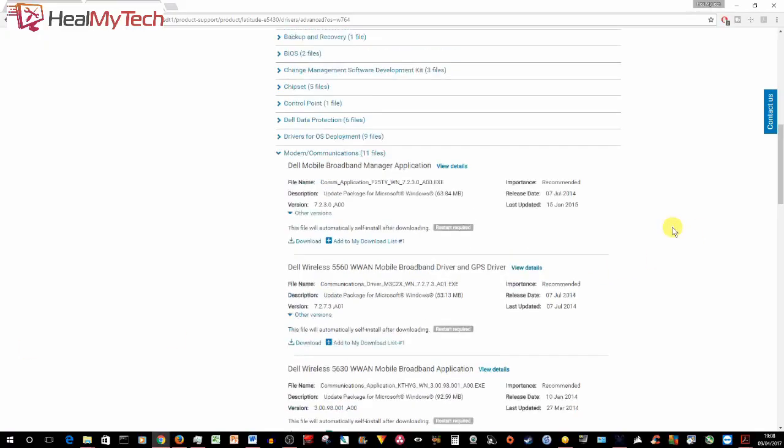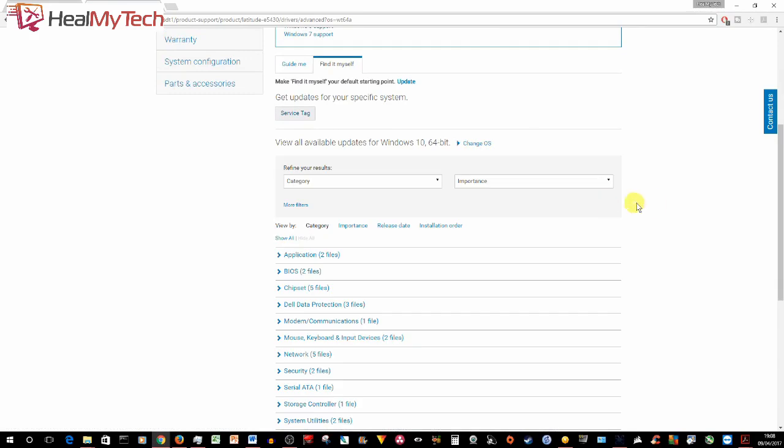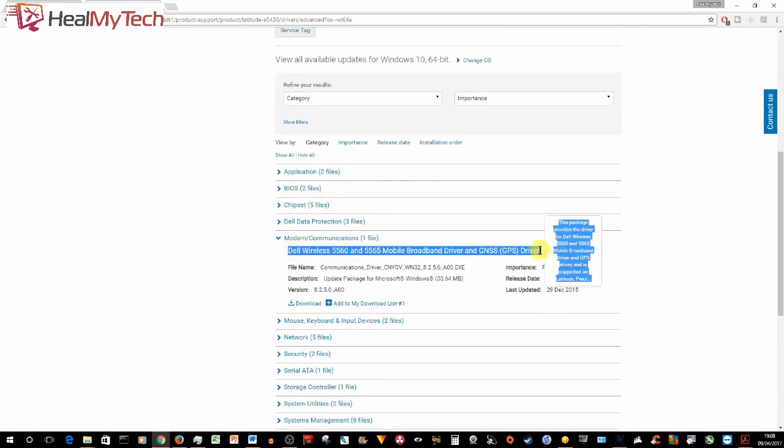A word to the wise: initially I tried installing the single driver available for Windows 10 64-bit which was already on the laptop. Unfortunately I struggled to make it work — the driver would not install and the card would not be recognized. I even tried a few third-party drivers but no success. Windows 10 is a big problem when it comes to support for hardware for which manufacturers have not or will not issue drivers. So I tried my luck with a fresh Windows 7 installation, and voila — that one worked. Dell will probably not be updating or fixing that driver for Windows 10 anytime soon, so there's no point waiting. It works fine with Windows 7. The client wants to keep Windows 10 and have Windows 7 as a dual boot on this laptop.